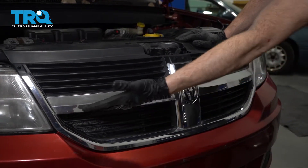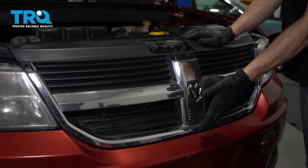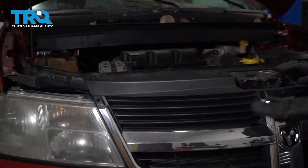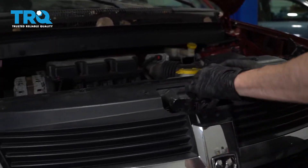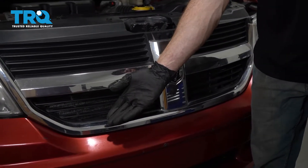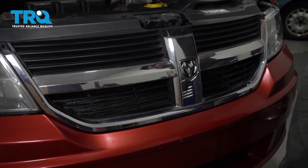It's time to get started on replacing our front grille. To do this, it's going to be easiest to see and do with the bumper cover off. We're going to have to remove all of our upper push pins across the top. If you wanted to do this without removing the entire bumper cover, you could carefully try pulling this apart and sticking your arm inside to start releasing the tabs, but I'm just going to remove the bumper cover so you can see exactly what's going on.